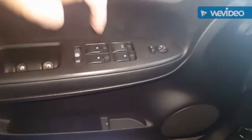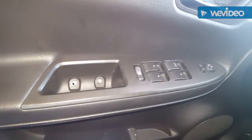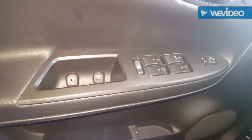When you're taking the panel out, you want to pull it to the left and pull it to the rear because there's a lip over here that catches it. I'm going to take it off and get right back to you to show you the clip locations so you can do that when you need to.